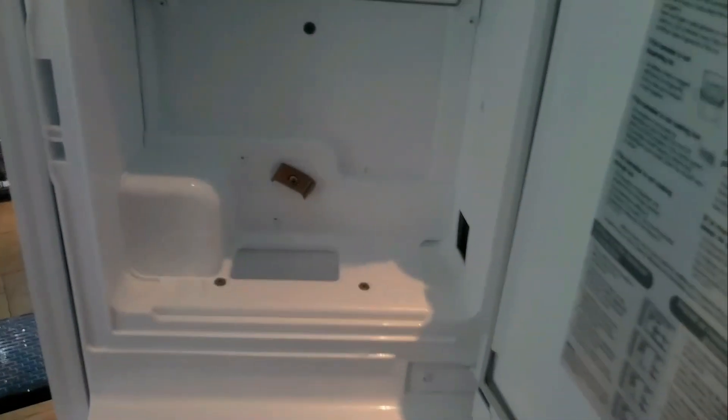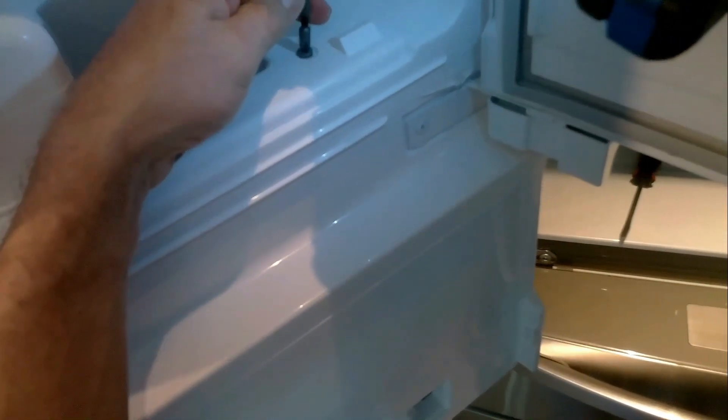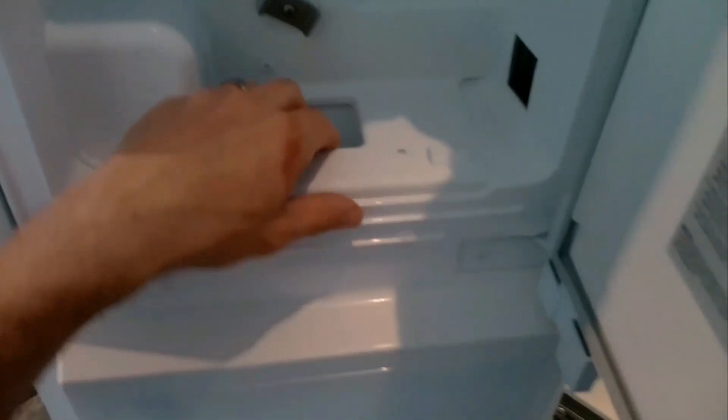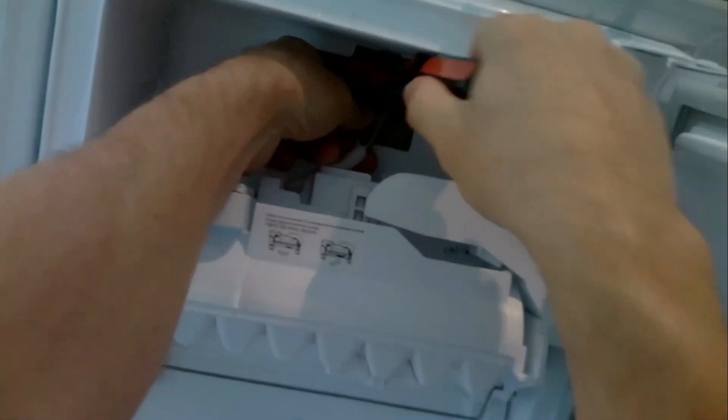So now let's remove the ice maker. Just open the door. Here you have two Phillips screws at the bottom, one in the middle, and one here at the top. I would have a long Phillips or a drill with a long enough bit. Just make sure you hold on to these as you remove them because they will fall and you might lose them. This one is a little bit of a pain to get to, but just take your time and be gentle. Once you remove the whole ice maker assembly, just grab it with your fingers, lift up and pull forward. You'll then have to remove the harness — take a flat head and press the clip in, wiggle it until it comes loose, and take the whole housing and put it somewhere safe.